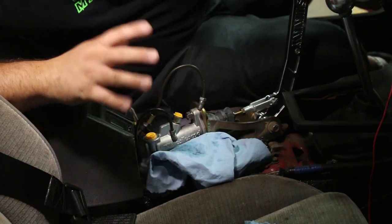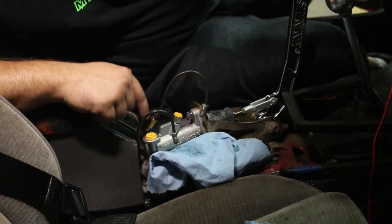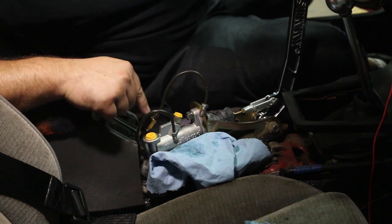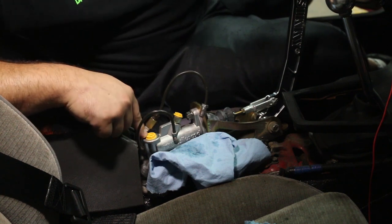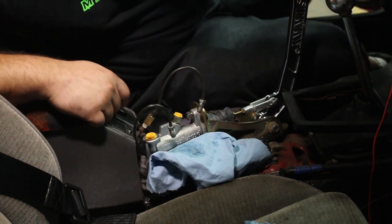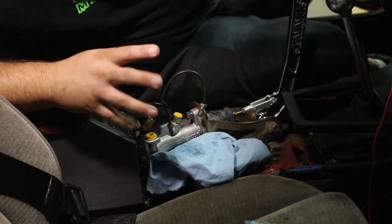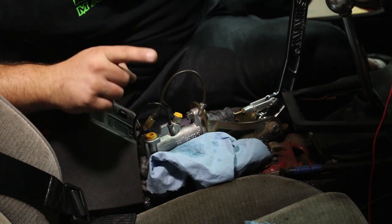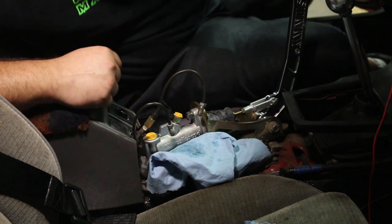All right, so to hook these up, it was actually really confusing finding a way to hook it up to this port right here, because this is a 7/16 by 20 threaded hole, and there really aren't any brake line fittings like this for a 7/16 by 20. So I had to get a banjo bolt fitting and kit, which took me a while to find, but lucky for you, I'll have a link in the description if you need something like this.